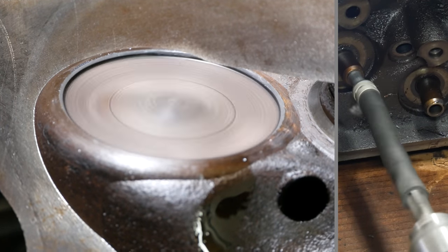With the keepers dropped in and held in place, we can start loosening the compressor. And once it's locking the keepers in, we can fully remove it. And just like that, one valve is fully installed. We'll go through the same thing and pop back in its companion exhaust valve with its own rotator, seal, spring, and retainer, compress the spring enough to reinstall the keepers, and remove the spring compressor to finish its installation. All that's left is to do that for the other six valves in this cylinder head. Luckily, that went smoothly and without issue.